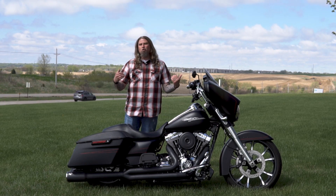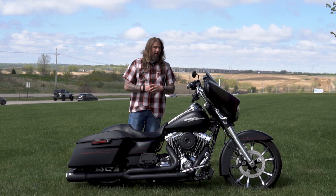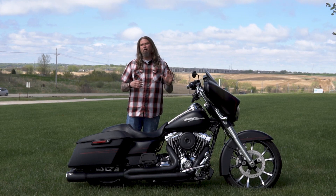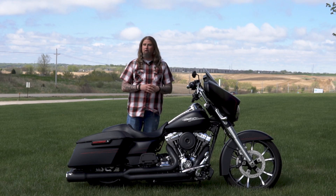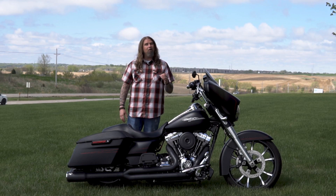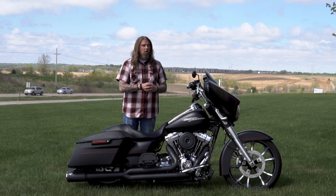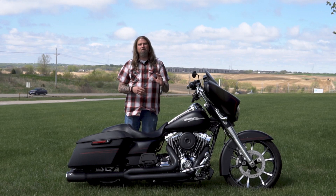This brings me to the tip of the iceberg for the day — let's talk about black denim paint. It is important for people who have never owned a black denim motorcycle or any of the denim series to know: these bikes do need special care for the paint. You need to pay more attention to the products you're using. Read up on it, talk to the parts guys, and make sure you know what you're doing because you can very easily ruin a denim paint job. You need to use specific denim paint polisher and cleaner — you cannot buff these motorcycles or put normal polish on them. They need a very specific cleaner.